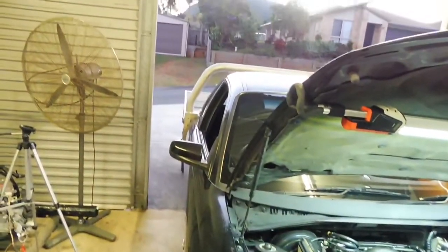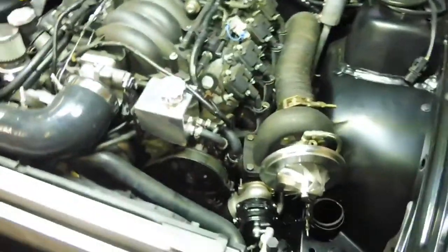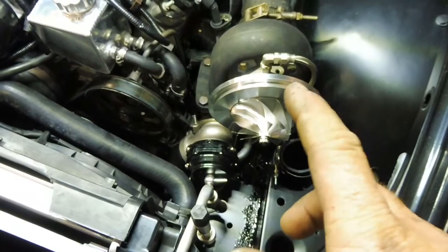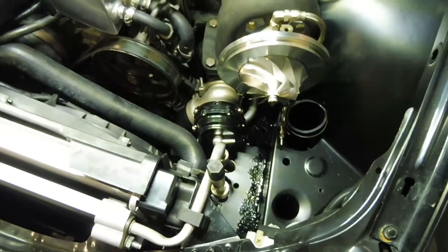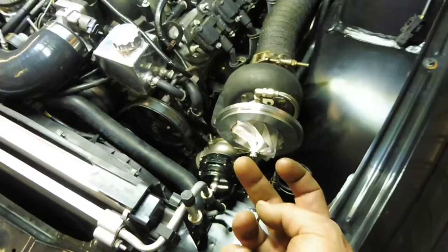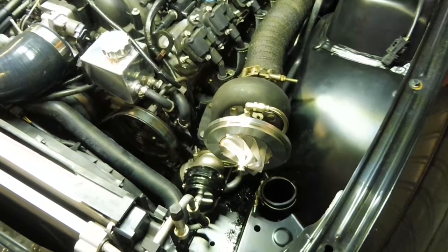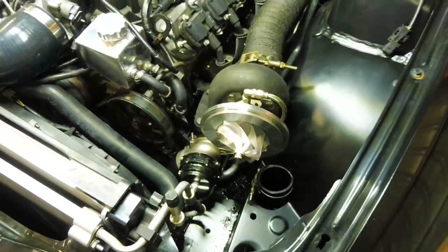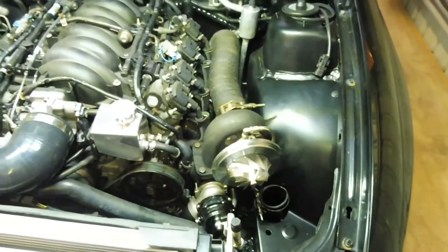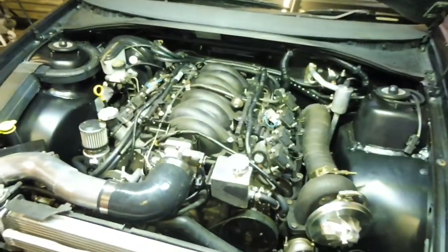Now I have got the tray all back on after putting that fuel pump in. And I just thought I'd share one of my hiccups on my little drive to get a wheel alignment today. Come back and inspect it, and I'm pretty sure the fitting on the return line is leaking. So it's one of the problems, I suppose. Everything else went well. I noticed a bit of a leak, so compressor housing off so I can access the 2 bolts, take that off, check the gasket, maybe put a bit of silicone sealant on there, put it back in, nip up the dash 10 line and hope it doesn't leak again. But yeah, just some problems do happen, and I've got a little bit of a leak on the return. We'll get it sorted, then I'll throw the injectors and the map sensor in.